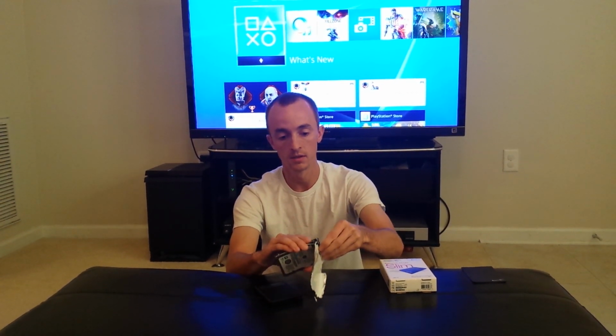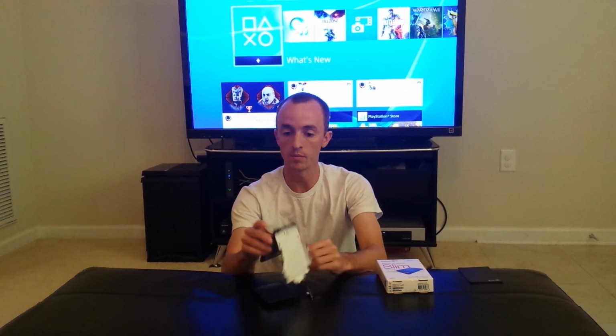At this point, on the 2 terabyte one, you'll see right there, it is in fact the Samsung. It'll be labeled Samsung. Back here, it'll have the M9T branding on it. So you actually see it is in fact the 2 terabyte M9T. That's really impossible to find other than inside these drives. Here's your adapter. It goes from SATA to USB. Really simple. Just pull it out. Now you have your SATA open.